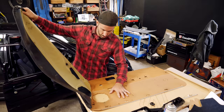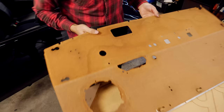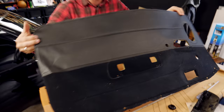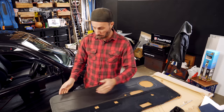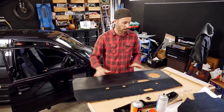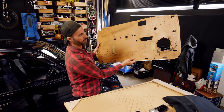That is the door card material now removed from the door card. You can see why we're replacing this — you can see all the water damage and where some of the clips are is completely destroyed, so this has been held on just with gaff tape. When it comes to your material choice, from the factory we've got this two-tone thing going on, and down the middle this is heat sealed, almost like a vinyl weld. That's going to be really hard to do at home, so if you're replacing it with material you're probably just going to have to go with one kind of material. If you want to go duo-tone you might be able to get a trimmer to do it, but if you're DIYing at home, one piece of material to go over the whole thing.